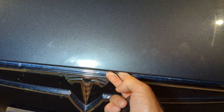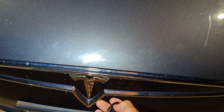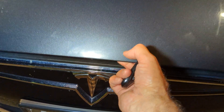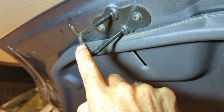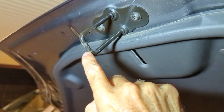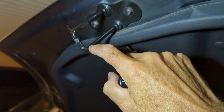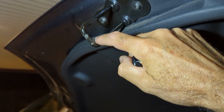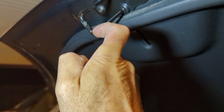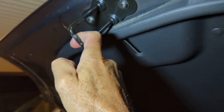You can hear it's not touching at all on the striker, so I'm pretty sure it's working correctly. Opening it again, you can also see on the striker where the paint is missing — the primary latch hits there and the secondary latch hits there. I want to make sure there is still clearance between the back of the striker and the latch, to ensure nothing is going to bind the secondary latch from going behind the striker and holding onto it.